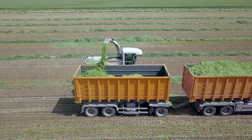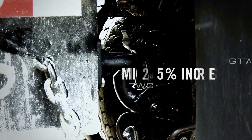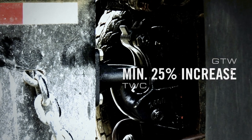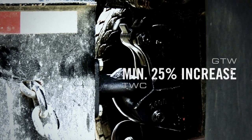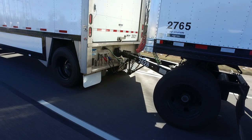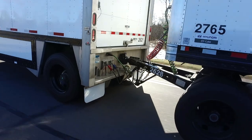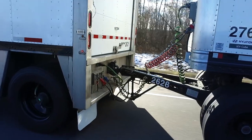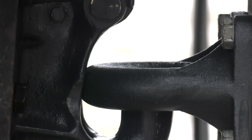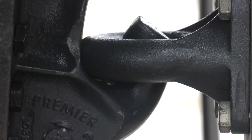The third step is considering your operating conditions and environment. In general, increasing the gross trailer weight from step one and the tongue weight capacity from step two by a minimum of 25% will be sufficient for many applications. However, each application is unique and every environment different. Therefore, your application may require more than 25%. Once both gross trailer weight and tongue capacity weight have been determined, evaluate your operating conditions and apply an appropriate margin of safety.